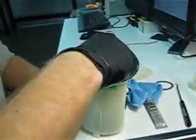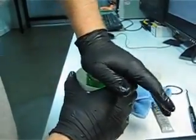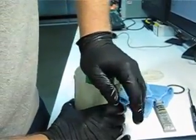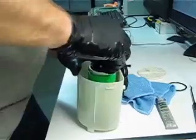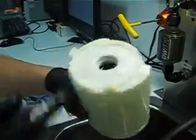And then at this time, go ahead and install the pump. Notice that we've got the O-ring in the proper location. The hole is exposed. Push it in, and you'll actually have kind of a staged... there we go. So now the pump stays in. If it doesn't do that, it's not fully installed, or it's not fully seated on the bottom.